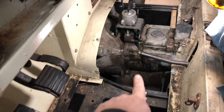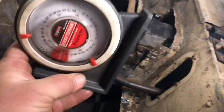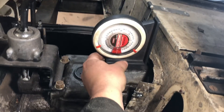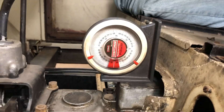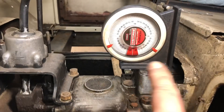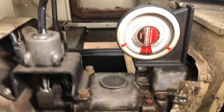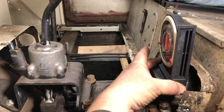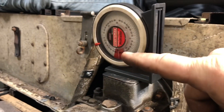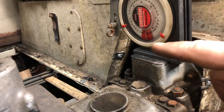Now we're inside the truck. I took all the floor pans out and removed the transmission tunnel cover. I took the protractor again — probably remeasuring a lot of things, but I did it anyway just to have more than one reference point. To confirm those other numbers, we're just about at half a degree again here — another half a degree. All our numbers are coming in close to about half a degree off zero. Turning it the other way on the plate, we're right at zero degrees, so the transmission is sitting horizontal, same as the engine at the thermostat housing.